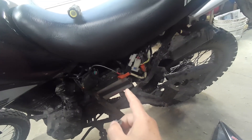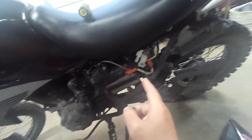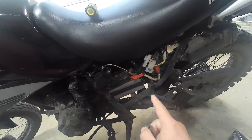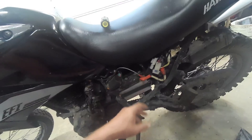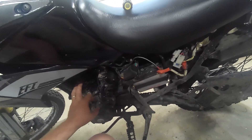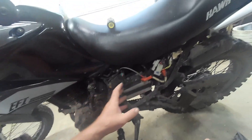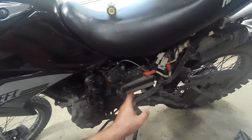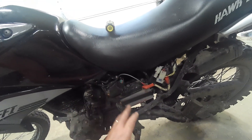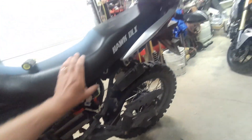I'm putting an air pod filter on this fuel-injected motor because I did a modification to the tune in my prior videos — you can go back and look, I even put the link for the tune. So if you're just going to put a pod filter on without doing any kind of tune, it may run leaner. Fuel injection is supposed to compensate for it, but I've heard it doesn't make much of a difference with a pod filter if you don't do a tune.